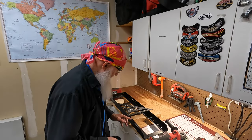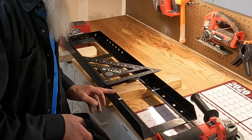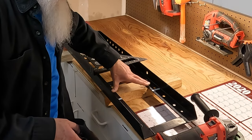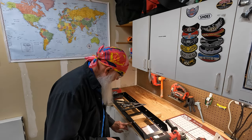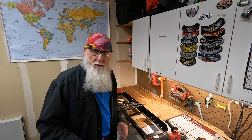I've laid out about nine and a quarter inches to take off this frame — that's going to give me quite a bit of extra room. I've already drilled an extra hole here and I've got room for one more for a little more adjustment. Once I take this off, we'll clean it up, touch it up with a little black paint, and mount it back on the lift.